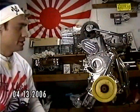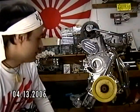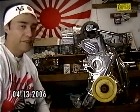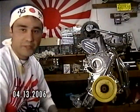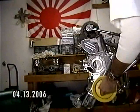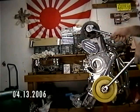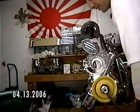What we'll do is time this motor to top dead center, compression stroke. To do that, take the valve cover off — everything is based on looking at the front cam. The intake lobe will be in the 10 o'clock position, the exhaust will be in the 2 o'clock position. Then get the crank sprocket, look at the second lobe, and turn it until it comes up on the mark.